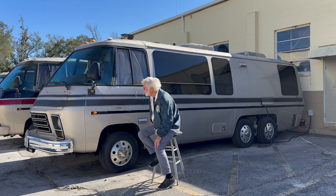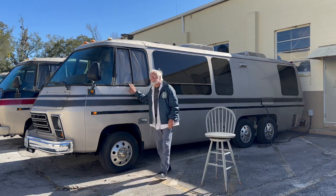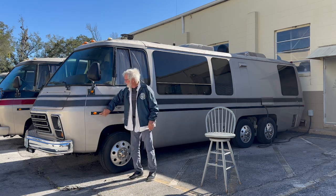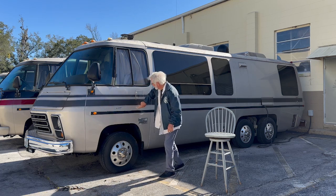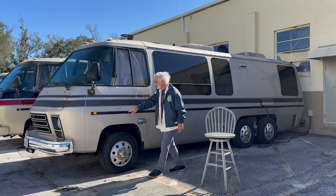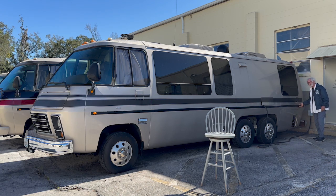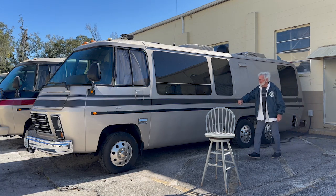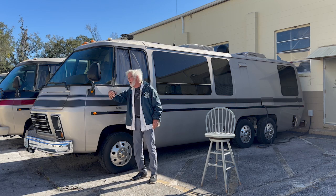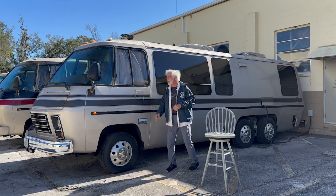So you've determined you're going to do this. First step: take it apart. Body molding comes off — if it's an early model you've got corrosion to clean out and fix, or you can change it to the late style. If it's a late model, the molding may already be loose and falling off. Mirrors come off too. A telltale sign of a cheap paint job is paint lines everywhere because the painter just bagged everything.